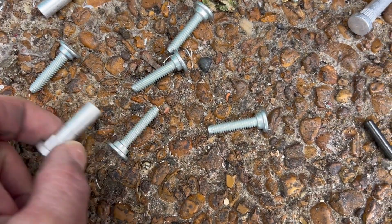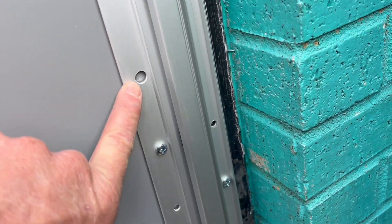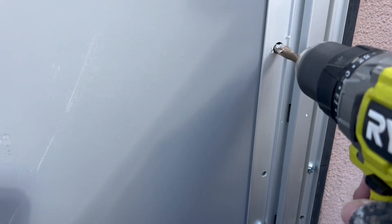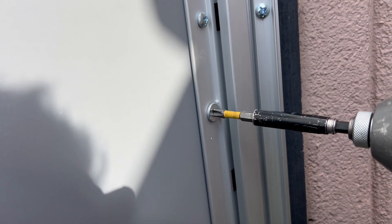I put in six to eight self-tapping sheet metal screws, and then we have through bolts. I recommend at least six — drill these out with a three-eighths inch drill bit. It gives you a little center punch to get the hole started. Whenever I'm doing this I bring fresh drill bits, especially the three-eighths inch bit. Take the female end of the through bolt, put it on the inside of the door, give it a little tap — sometimes I put a piece of tape on them. Go to the other side and thread in the male end; it connects very easily. Just don't go too deep and dent the door.